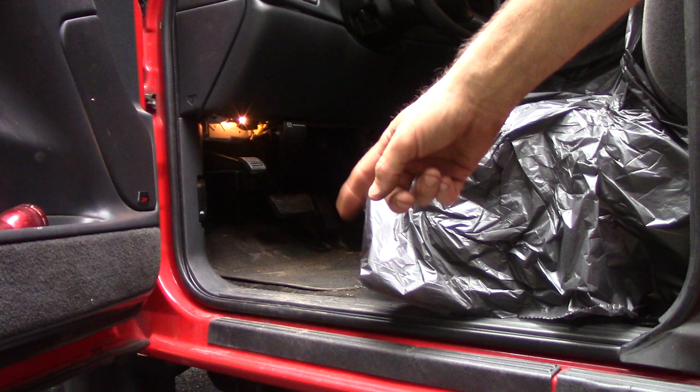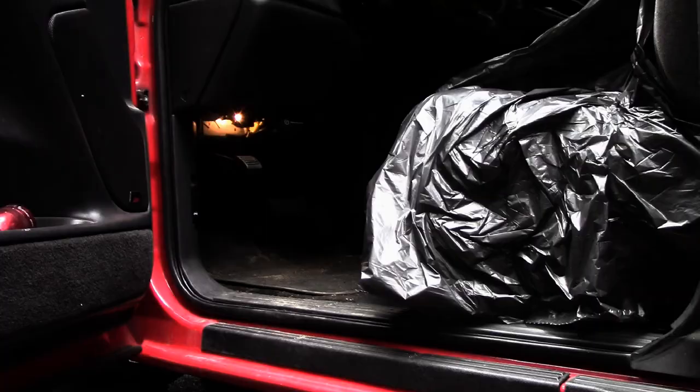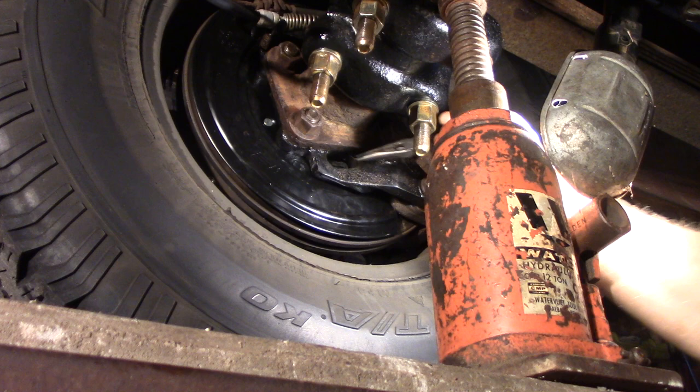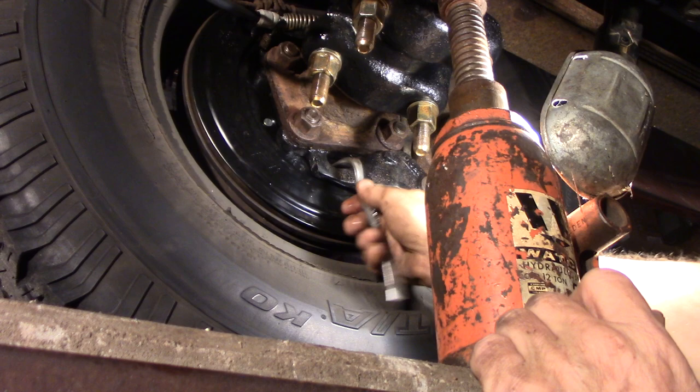Two things left: I have to adjust the wheels — I need a couple turns out. I also have to put some fluid back in the rear end. Let me get to that and see if I have to adjust. I did the other side — what a chore! Getting up in there one click at a time. This is going to go way easier, we expect. Get my little plug out, get my wrench in, I can see the stars — the down direction is out.